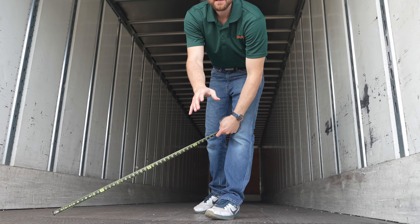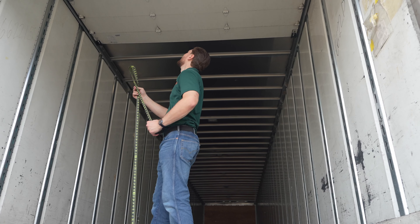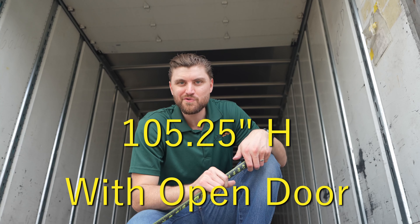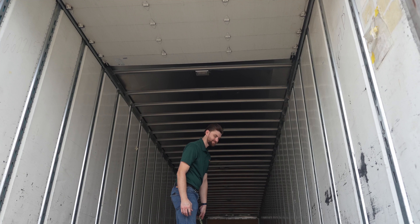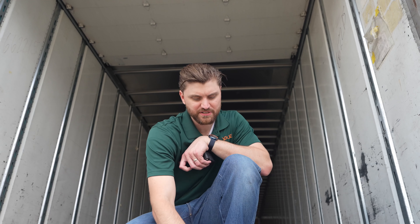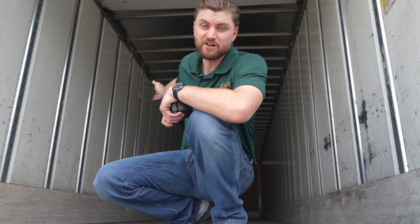On height, once you're clear past the door the measurement is 109.5 inches. But with the door and its little hinges you're only going to get about 105.25 inches — significantly less. From the actual end of the trailer once the door is open, you have to deal with 101 inches before you can take advantage of the full interior height. So anything you load needs to be able to fit under that 101-inch threshold at the entry — the taller interior height is essentially irrelevant for that first section.